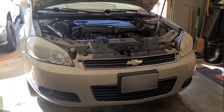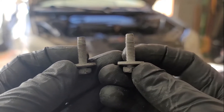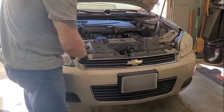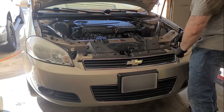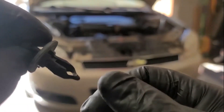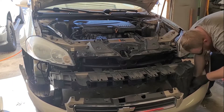When I pull the bumper off I'll show you how these bolts and that nut work. These are the two bolts that you take out from the more rearward part of the bumper - more towards the rear of the car are these two 10 millimeter bolts. Next is remove hardware from the top. There are these clips here - pull the plunger and just pop the whole clip right out of the hole. There are four of those on the top. You've got to unplug the fog lights.